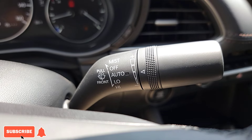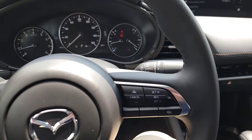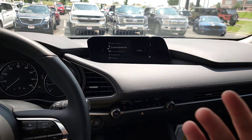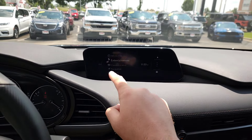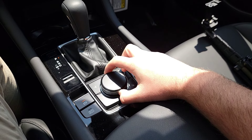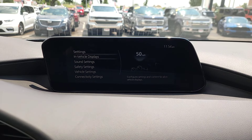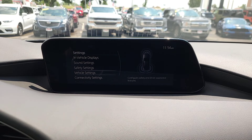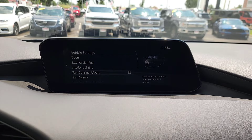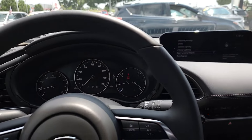So they are temporarily off. Now if I want to simply turn them back on — there we go — because I got done going through the car wash, and we're good to go. But now, let's say if you actually want to turn them off permanently and never use them for any particular reason, that's alright. Mazda has allowed you the opportunity. You've got your center display right here. Come down to the wheel, go left and right to navigate, and push that button in. Go to Settings, then Vehicle Settings, then come down to Rain Sensing Wipers. Uncheck that. Now they're completely off. There's two ways to do it.